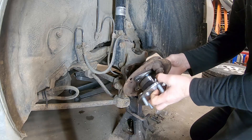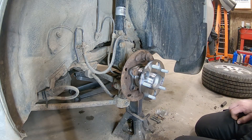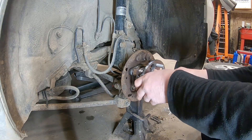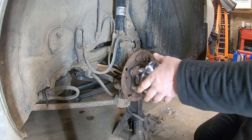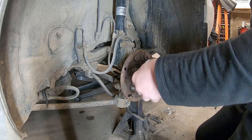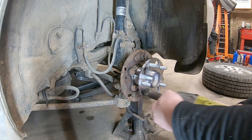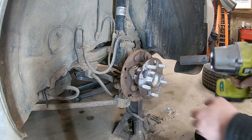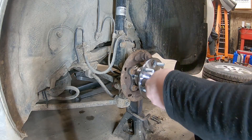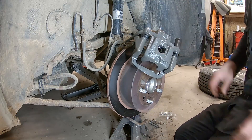We're back with the correct wheel bearing now. We've got to put our backing plate on, line this up with the hole, slide this in here. We're already in better shape than we were yesterday — this wheel bearing is in much better shape than the other one. Let's get our impact and turn it down to one to start, just to run these bolts in. If you're interested in a review on this 18-volt brushless impact, let us know in the comments.